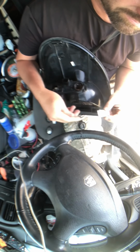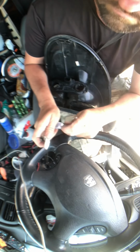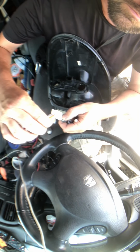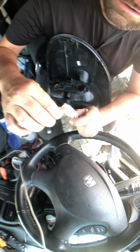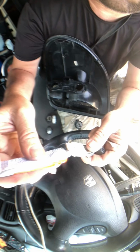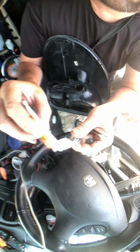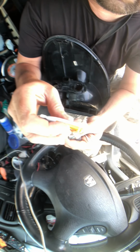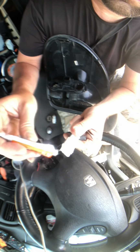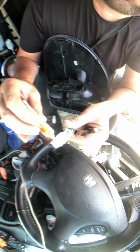And we'll put the dielectric grease right here, right on the bottom. What we're doing is just making a barrier. So you put it right here along this edge, and when it slides in, it'll push tight. So I'm gonna put some on the bottom too, like that, and over the terminals. And I'll just put it on the whole thing. That way there'll be no air gaps in here. Zero air gap. Sound good? Sounds good.